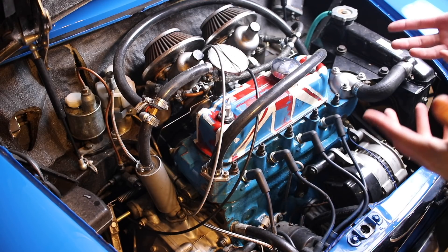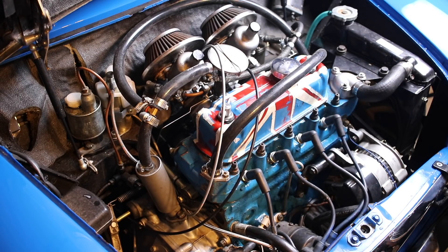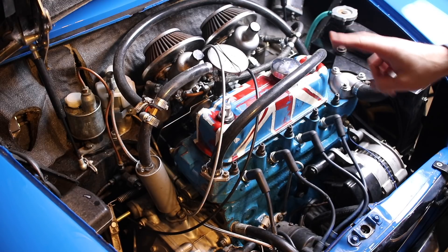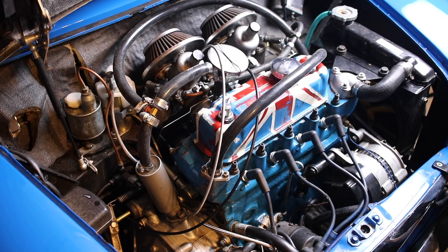This is something that can happen to really anybody who has a Mini if they're not careful, or if you've got a leak in your gasket around the valve cover. To resolve this, I'm going to put the old valve cover back on here because it sits a little bit tighter. I'm also going to put a new gasket on here. Even though this gasket is technically good, I'm going to go ahead and switch it out, put a new gasket on it — I've got one in my shop — just clean it and get something new and good on here.